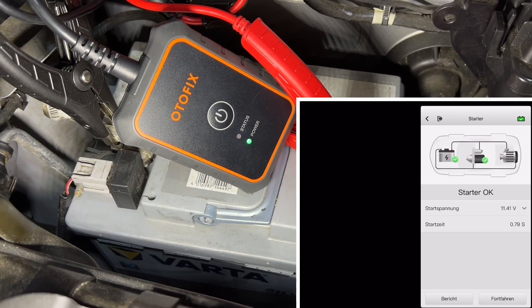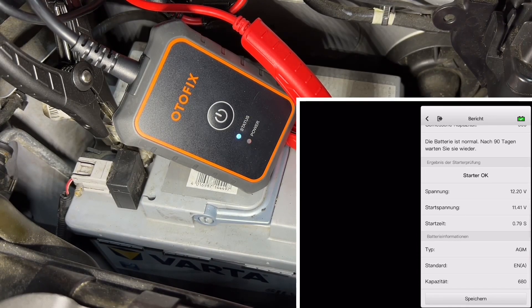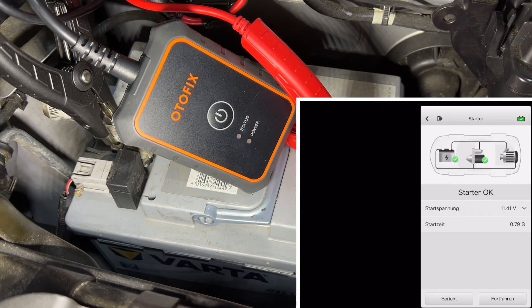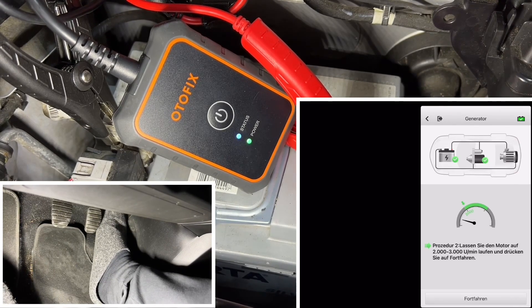Before you start testing, you should inspect the battery. Check for cracks, bucklings, or leaking — if you see any of these defects, replace the battery. Check for corroded, loose, or damaged cables and connectors and repair or replace as needed. Clean any corrosion on the battery terminals and dirt or acid on the case top using a wire brush and a mixture of water and baking soda. Wear protective glasses and gloves when working with batteries — that's really important. Then power up the device.